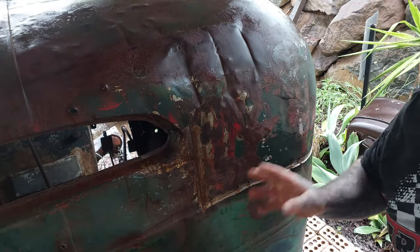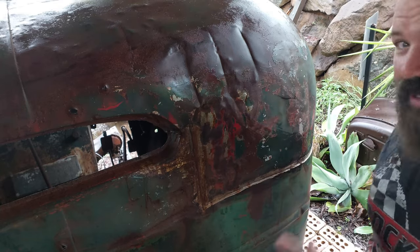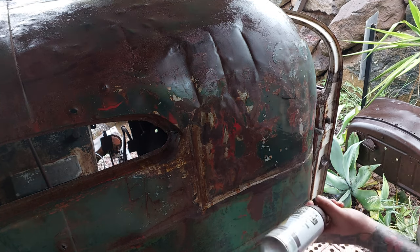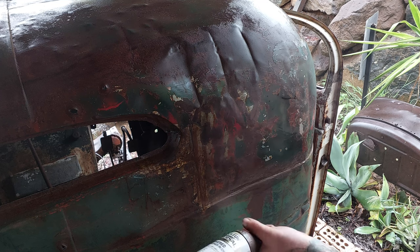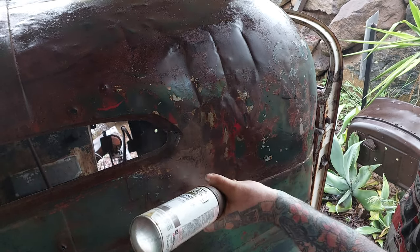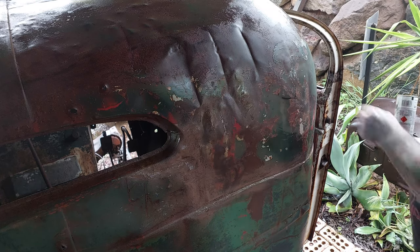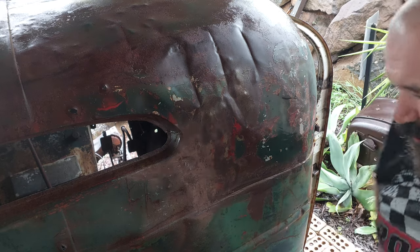All right, we are back. Now, let's attempt to do this patina painting. First step, we're going to throw hammered paint and primer in one. We're going to throw a little bit of that down. Apologize for the lighting. We are in total darkness. We've got another blackout. So let's squirt a bit of this around just on the actual bare metal section itself. Right, so there's our first bit down. We'll let that set up. What I'll quickly do now is I'll quickly just run around and do the other bits and put that down